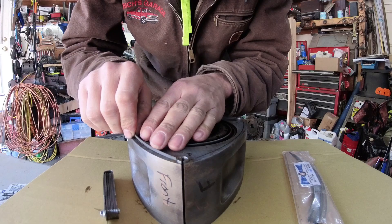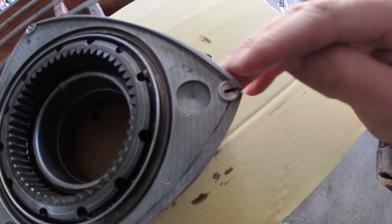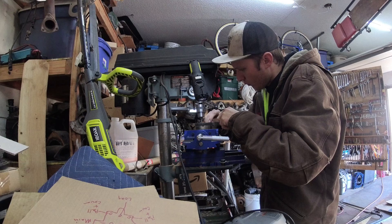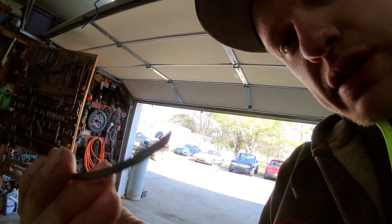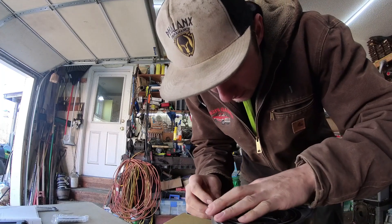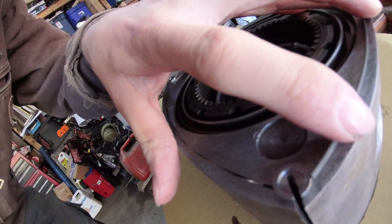Start with the number 1-2 side seal and see if it fits. Right away you can see it's too long — it won't fit in all the way — so we've got to take some material off. It's an iterative process. We'll take this over to the drill press and chamfer both ends right off the start, since these come straight cut. After chamfering both sides, you can start fitting based off of one side. It's still too tight — we need to take more off.